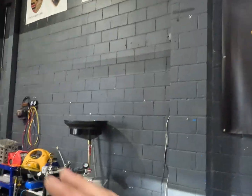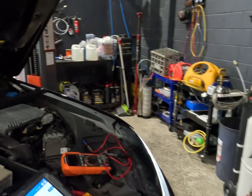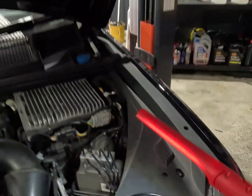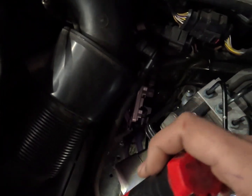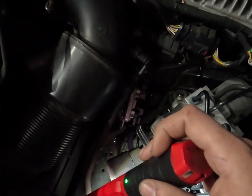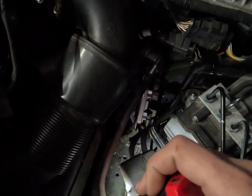49 and a half volts is fine - it means it's getting current through it. Apparently those batteries have been failing overseas in Europe and UK as well. But that's how the system works. As far as wiring inputs, it's just very simple: you've got your two 48 volt wires there, and you've got your wires down here. So we've got a power ground - so 12 volt feed, chassis ground, and two CAN wires - so your white and orange, which are your normal.